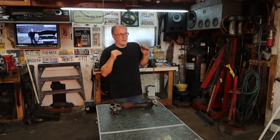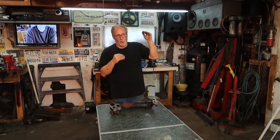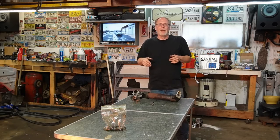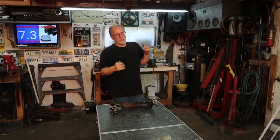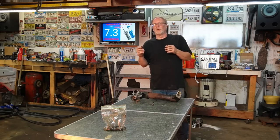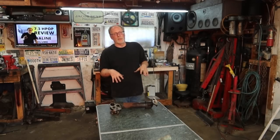So when you're running that higher thermostat and you're going up the hill, that engine oil is 230, 240, 250, 260, 280, and it's boiling off. That's why, if you've ever seen these oil tests on YouTube and other places, they pour some in a coffee maker and determine how long it takes to vapor off. Well, that's happening in your engine. When you climb that hill with the high thermostat, you're taking the important items, the lubricosity, out of the oil, and it almost wants to start boiling. That cooler is there to cool it back down.